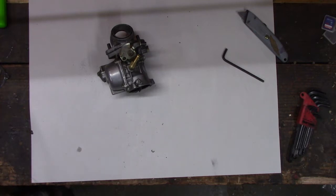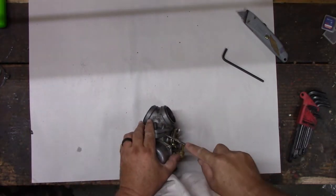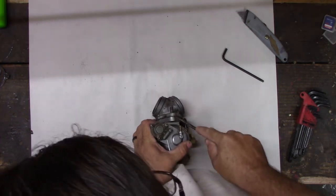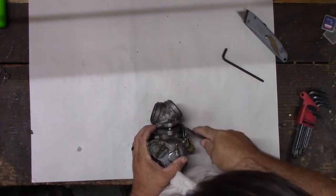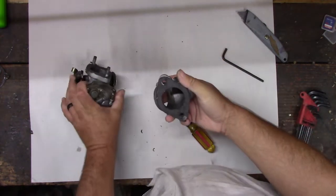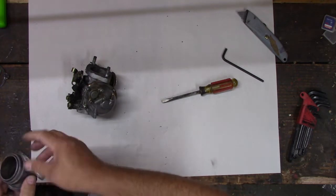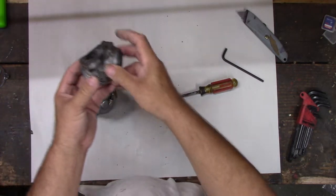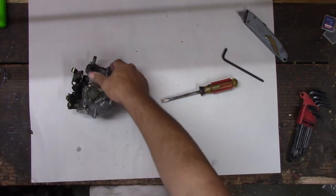Well, there's a lot of ways to approach it. I'm not sure. When I took it to the motorcycle shop, I think because it was running rich, or only running on the choke, they thought this was leaking. And I think their answer to make it stop leaking was to just glue it. But they could have done without that, right? Silicone doesn't always help. A lot of times if it's running like that, usually it'll run a little too lean. That means air is getting through here. So I think they glued it thinking maybe air was escaping here, and there's two gaskets that fit here too to hold it. I think they were thinking it had an air leak. But we'll see if we can figure out what's wrong with the carburetor.